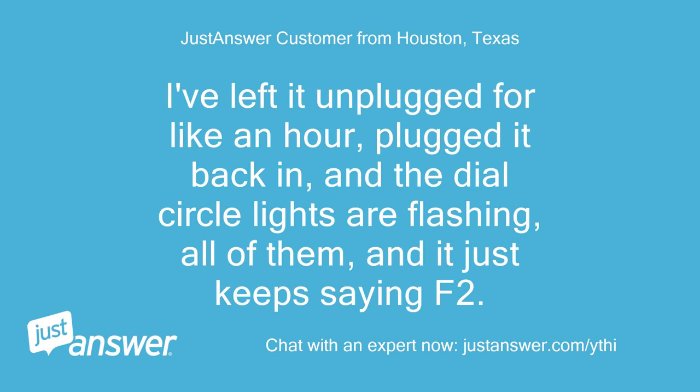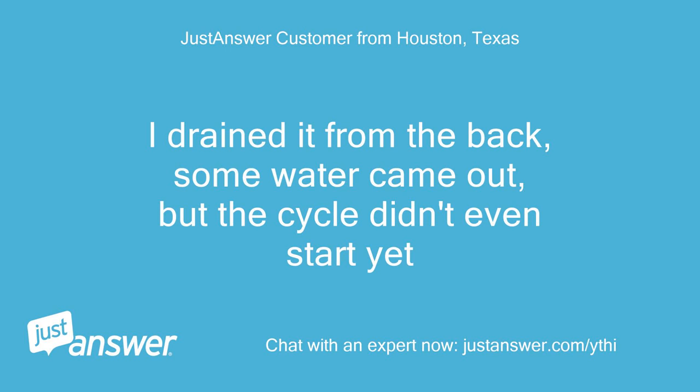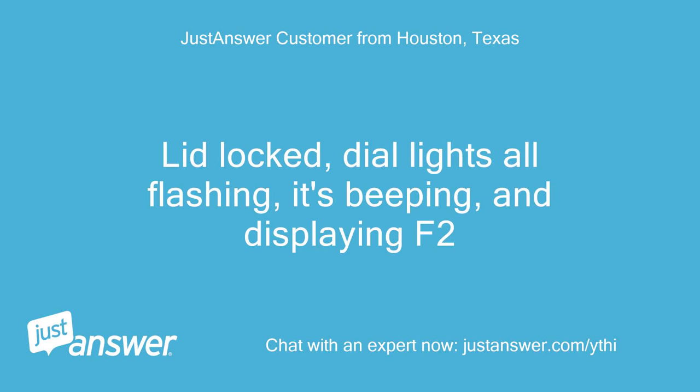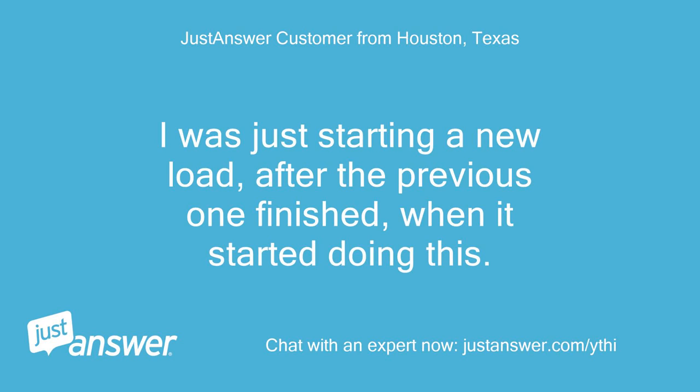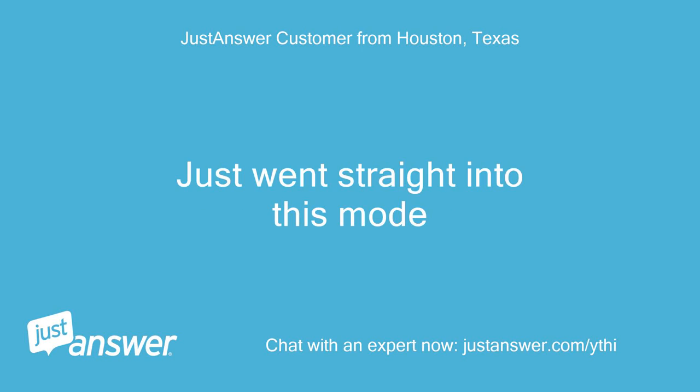I've left it unplugged for like an hour, plugged it back in, and the dial circle lights are flashing, all of them, and it just keeps saying F2. And the lid will not open. I drained it from the back, some water came out, but the cycle didn't even start yet. Tried to plug it back in and try again, same thing. Lid locked, dial lights all flashing, it's beeping, and displaying F2. I was just starting a new load, after the previous one finished, when it started doing this. No water even filled in. Just went straight into this mode.